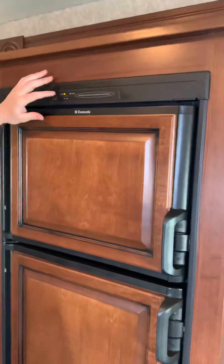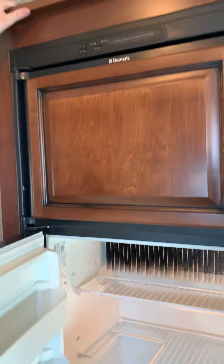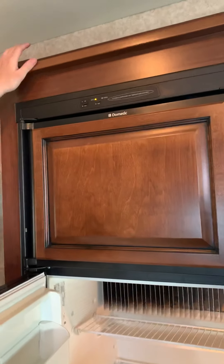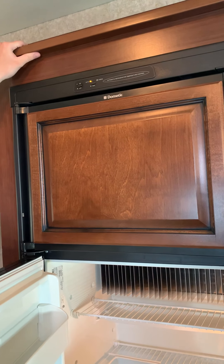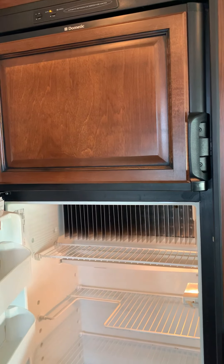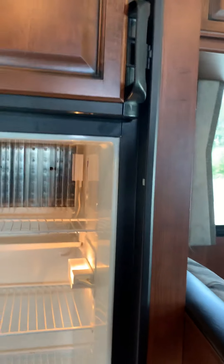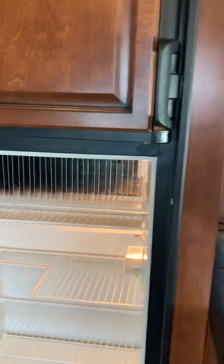Coming over here, turn the refrigerator on — you want to see that light come on. If that light is not on but the light inside the fridge is on, that means it's set directly to gas. You're going to prefer auto, so that it uses electricity at a campsite. In any event the power goes out, it's going to switch to gas. Right now we're not on power, so it's going to use its gas. Another thing to know about the refrigerator is up in the corner here — that's the thermistor, and it's going to read the temperature. The higher that this little white sleeve goes, the colder the refrigerator.